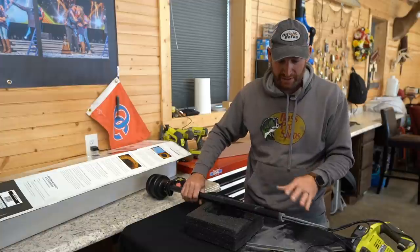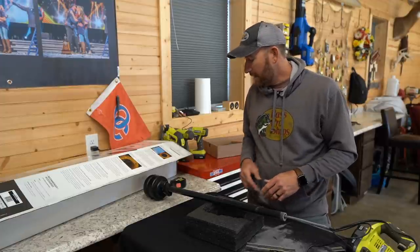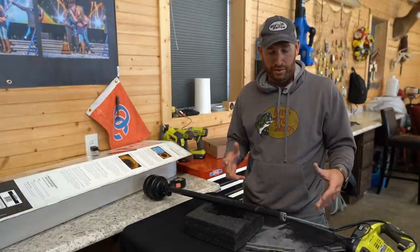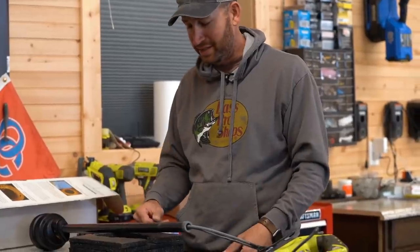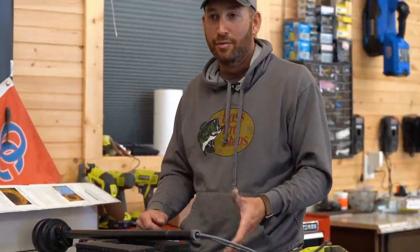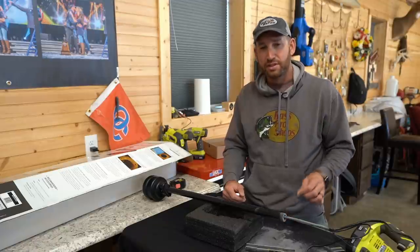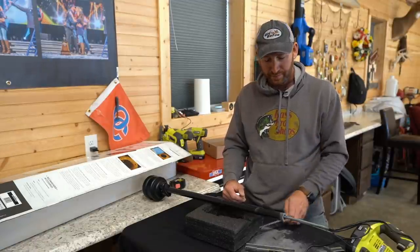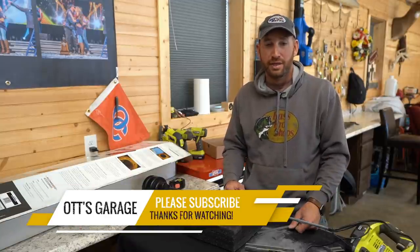So last up, just to finish it up and clean it up — I'll get a towel, wipe this off, put the grommet back on, and then it's just the install like you normally would, putting this on the bracket and then the bracket on the trailer motor and you're good to go from there. This is something I've done to every one of my 360s for the last several years. It's not terribly hard. This is the hardest way you have to do it, but I've done it enough that hopefully even this looks fairly simple — easy enough to take on, just protecting those wires. Using a file works really, really well for me, but using something to protect those wires while you're splitting down through there and you'll be in good shape.